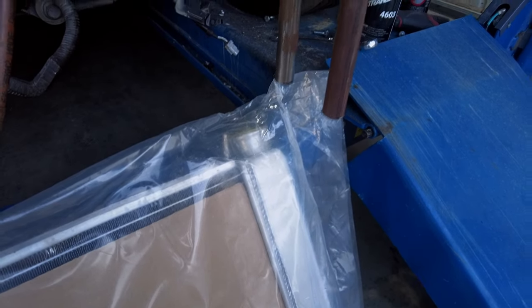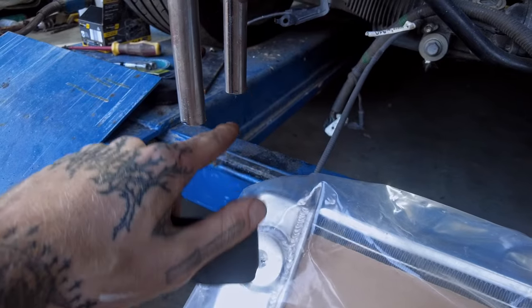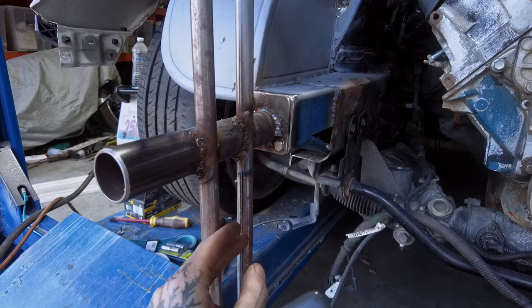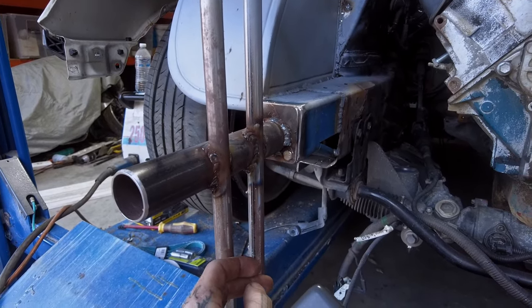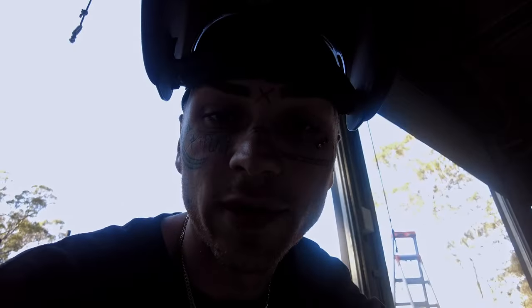Now I'm going to grab the radiator that's sitting here — it's too wide but the one I'm going to get will be the same height, so I'll at least get the height right and maybe make some bars across the bottom so I can call this front section structurally done and move on to all the other stuff I've been wanting to do. This one is 48 centimeters overall tall. The filler doesn't matter because we'll relocate that. Where I marked and cut these two before hasn't changed, but I didn't think about leaving it a bit over because I'm going to go tube across underneath. Once I've added the gussets and stuff it'll be really snug — I want it to be as nice as I can get it. I'll have a think about how I'm going to attach those and make it nice.